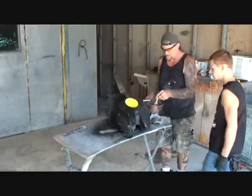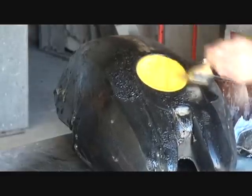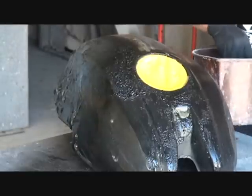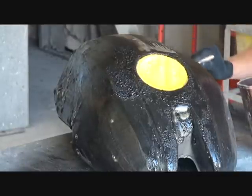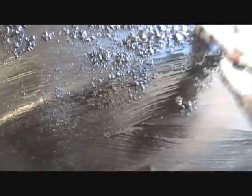Make sure you get every crack and groove. If you look real close, you can see it eating the paint away. This is going to be an easy strip. Now, Dylan, go ahead and apply the rest of that. Put it on very thick — thick and juicy. Dylan is applying the aircraft stripper to the motorcycle tank and you can see the stripper is activating as soon as it hits. Keep it real wet. As we look where I applied it, you can already tell we're going down to bare metal. Very easy, because all this was is some cheesy-ass primer and spray paint they applied to it.